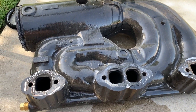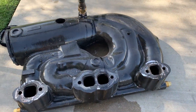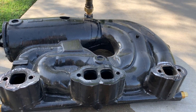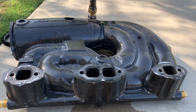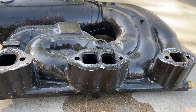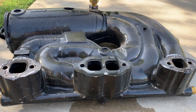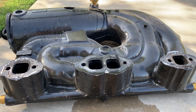It's always a good idea to check your oil. I didn't check my oil a few times out and it was really milky — I have no idea how long it was like that and I kind of lucked out. You can check your oil to make sure it's not milky, because that will happen when these things start leaking. It can really damage a motor — if you put enough water into the cylinder it'll hydrolock it, bend a rod, or do all kinds of damage, like rusting parts and seizing valves.